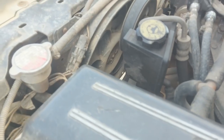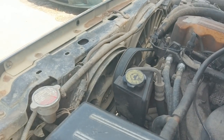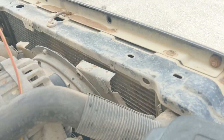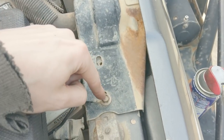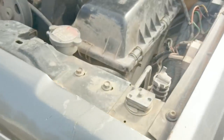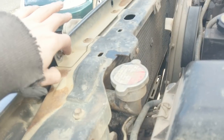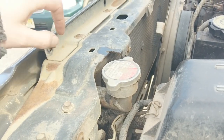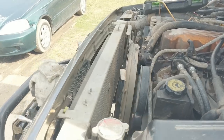So we're going to have to drain the radiator, probably pull the lower radiator hose, remove the fans, take off this upper shroud thingy, and then we can remove the radiator. So I got the fans removed, got that line removed — it's just a bunch of Phillips head screws up here and you can pull it out. This little Volvo fan doesn't like coming out too well. Next we're going to take off this top brace — we've got a bolt here, usually star bolts here and a really annoying one there. I never put that one back because they're really annoying to take off. Take these off, that off.